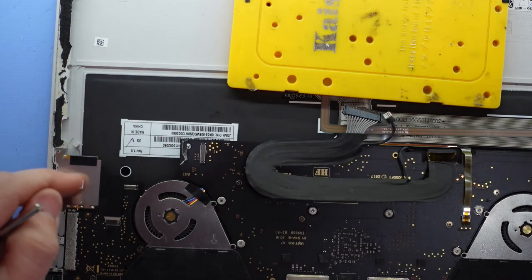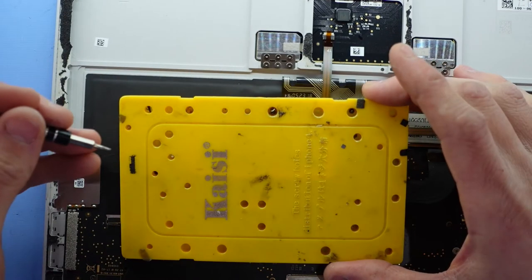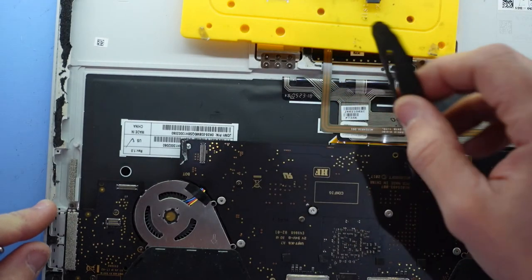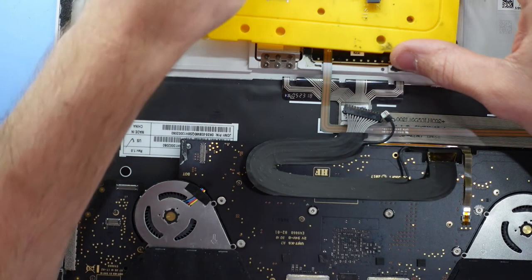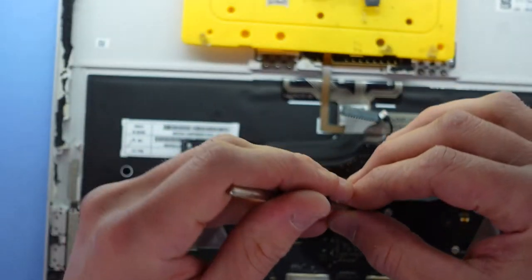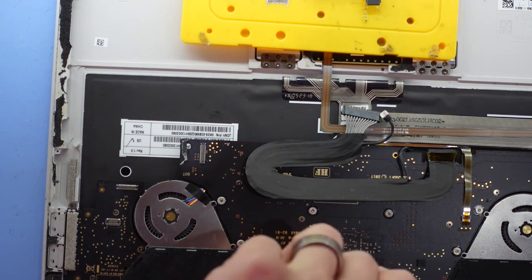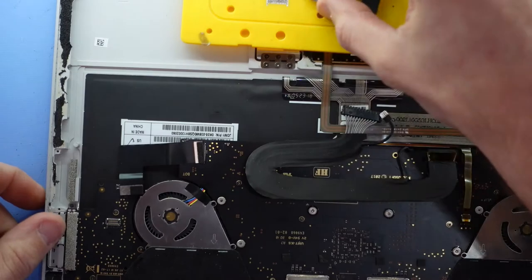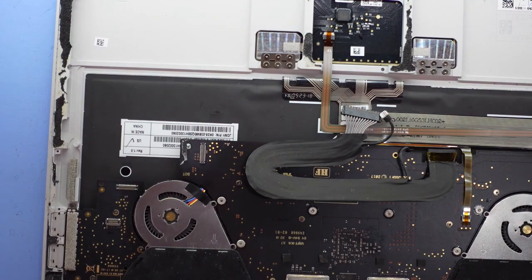There's also two more screws that go over the left-hand side here, which I would say one, two, three screws left over. I'd say two of them over here, and maybe a third just hiding somewhere, potentially right here, actually, now that I look at it. Ah, everywhere's got a place. There we go. So next up would be reconnecting this one and installing that one. And from there, you should have been able to change the thermal paste on your Microsoft Surface Performance Base, or Surface Book Performance Base. I'll be back in just one second.